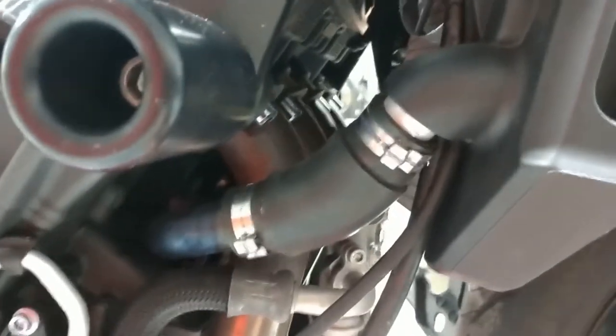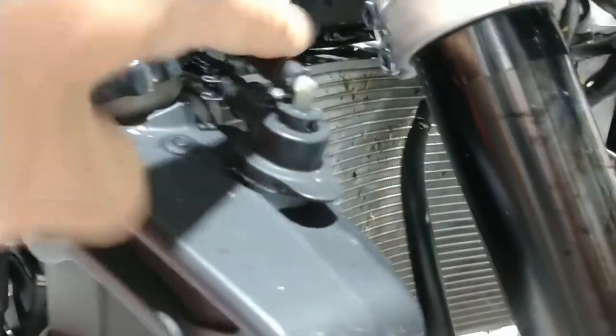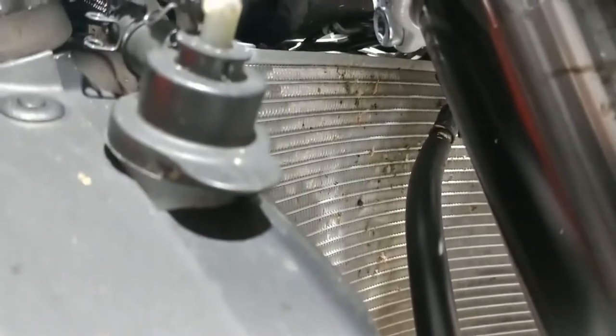You've got two options depending on what you're looking to do. You could remove the hoses and drop the radiator off the bike — just be aware that you're going to need coolant, it's going to take a little bit of extra time, and you'll need some special tools. We typically just lower it down a bit to gain extra clearance between the frame spar and the radiator. If your bike is newer and you're more particular, be careful — those fins are definitely thin and soft.